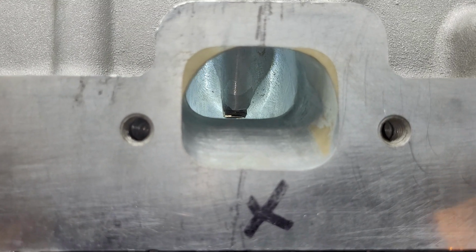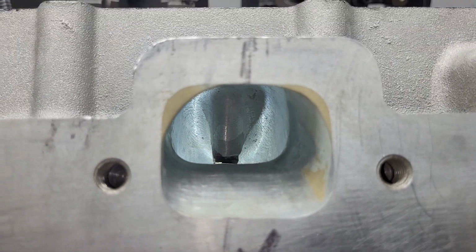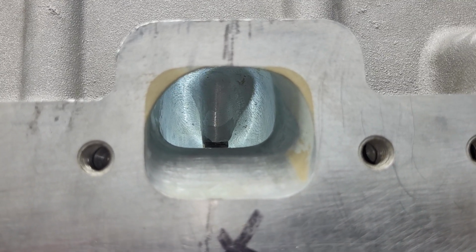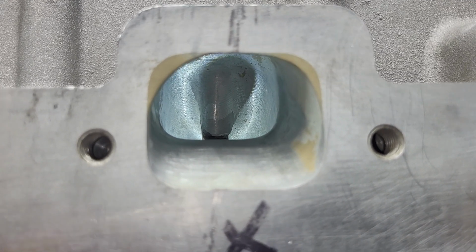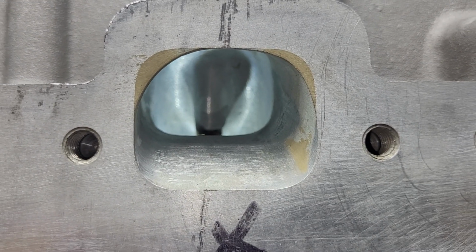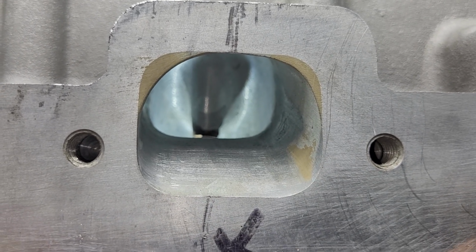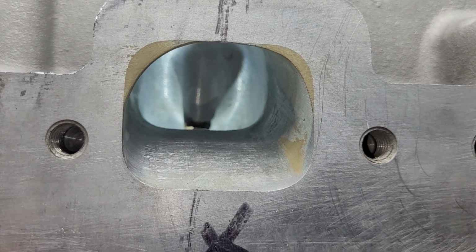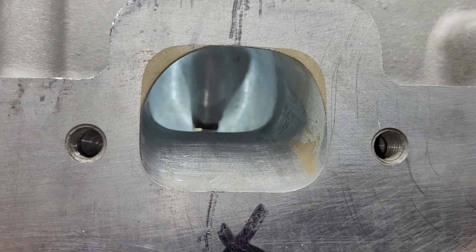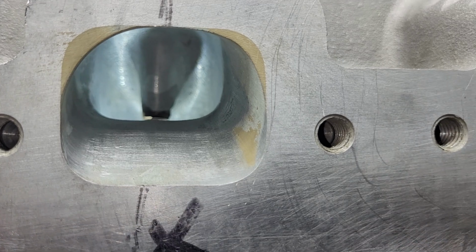Okay, he's got a D shape on. You can see it wasn't always a D shape, but he probably did some work to it, and it improved with a D shape. So we're going to probably keep that shape because he's already done the work to that. Now, as far as the height of the short side and the airspeeds across the short side, I may do a little work to that. I mean, I can already see where I think gains could be made.